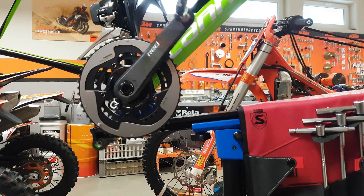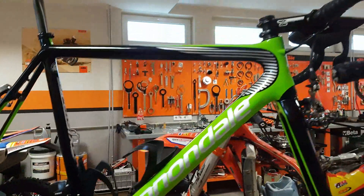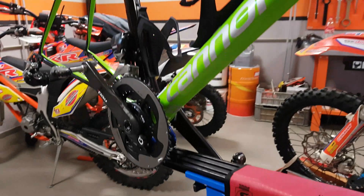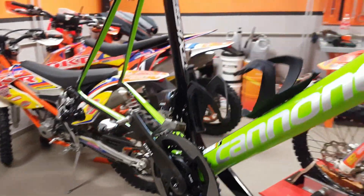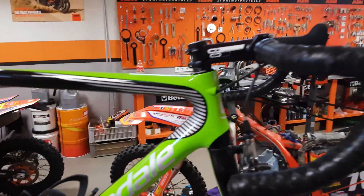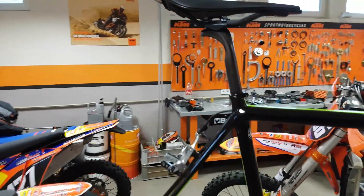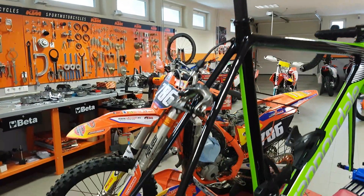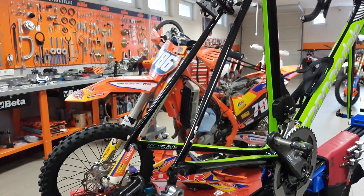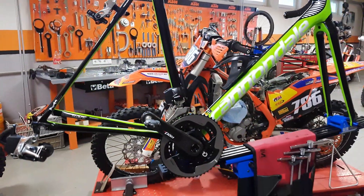As for the rest of the bike, as I mentioned, this is a Super 6 EVO 2017, and it has the PressFit 30A. All the older models of Cannondales have the BB30 bearings pressed directly into the frame, so that way you only need the bearings that I have here and you don't need to mess around with the cups. And if you have this newer model, then you should check out the description below.